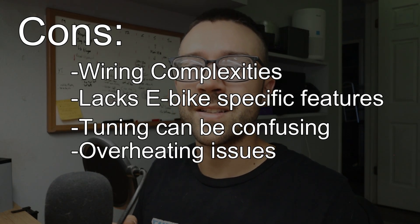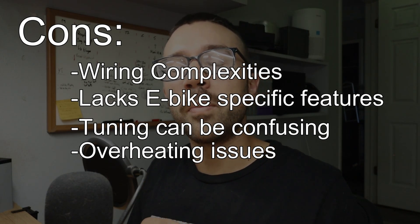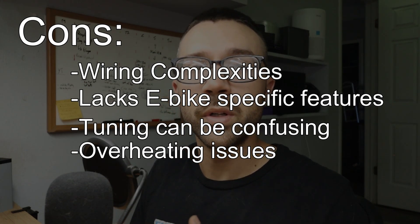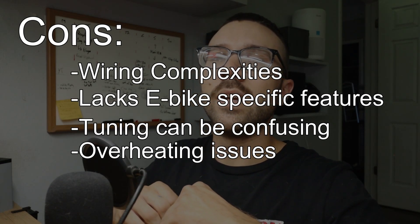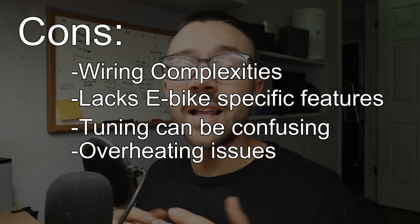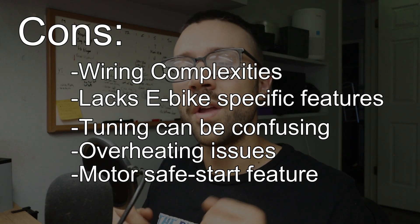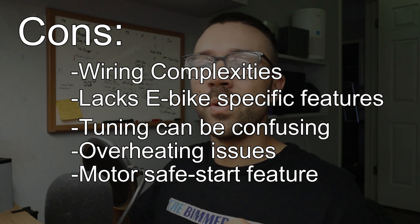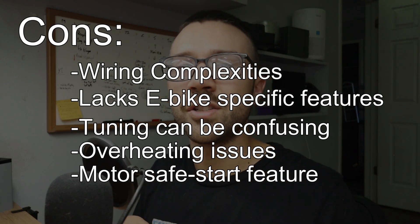Because these controllers are so small and put out good power, they do lack some of the cooling you might find on a Far Driver controller — there are no fins or ways to dissipate heat. If you order a larger controller like the 75/350, those can come with built-in cooling channels for liquid cooling. What some people do is mount these controllers to their frames so the frame can absorb some heat from the controller while riding. My biggest complaint is that when rolling backwards, there's some sort of safety start where the controller will not allow you to put on throttle to go forwards — so at a light when I'm rolling my bike backwards, I can't engage power.